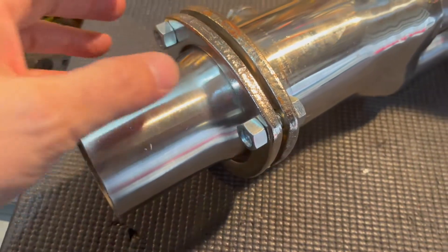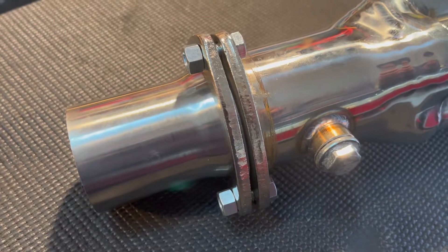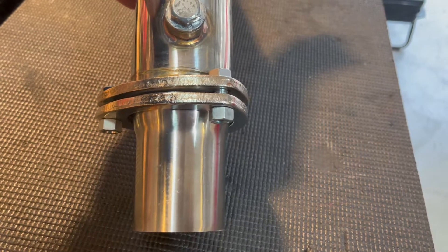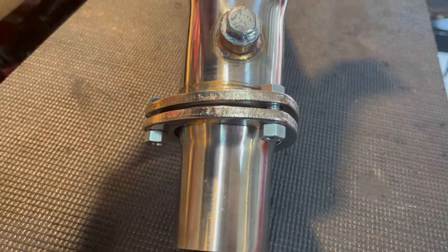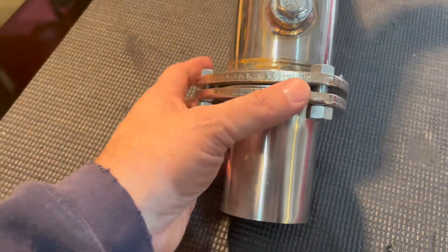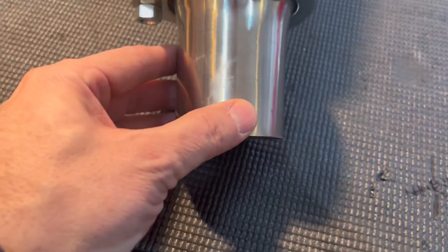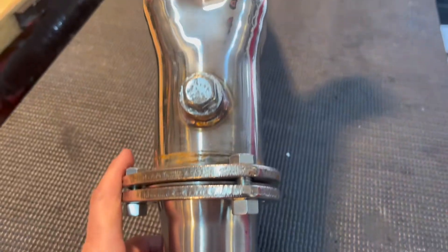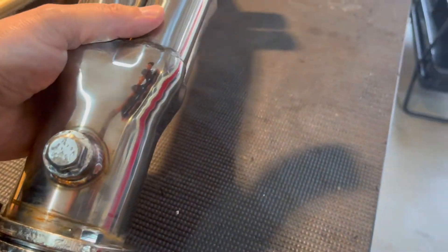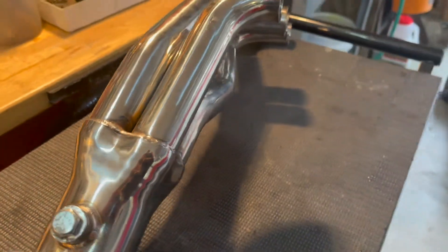What might be dicey after coming from the underside is the three-bolt flange with this two-and-a-half-inch collector - that could be tricky to clearance on the driver's side. I think if I can tuck in, I'm good, but I've still got a lot of things down there. Maybe if I don't have it on clearance, there's something I can do where I don't need the flange - I could weld around the circumference where they meet and then extend the pipe down. I might need to put the flange further down - I'll take a look at that.